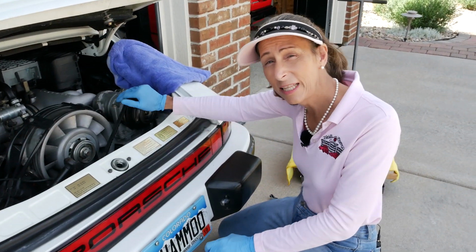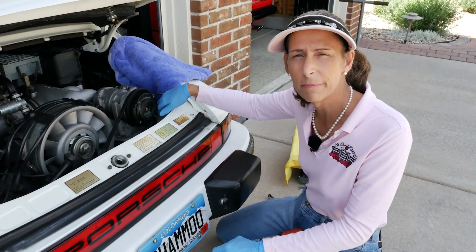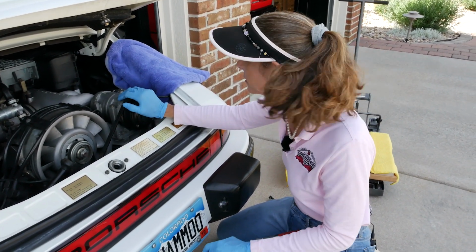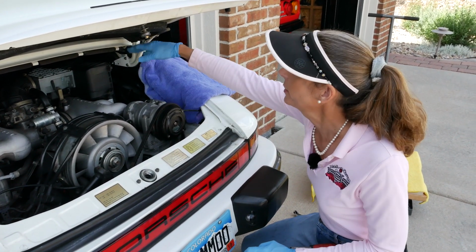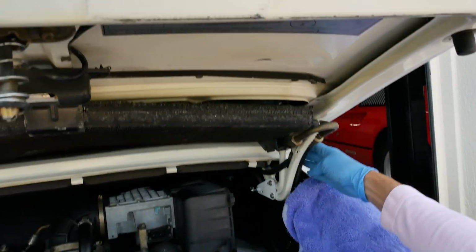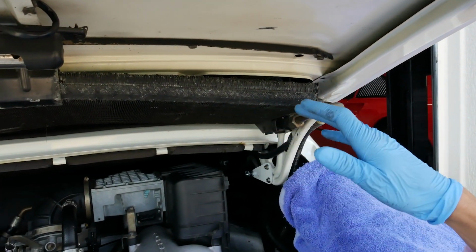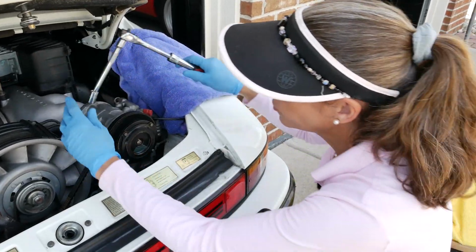We're going to start by taking the AC compressor off. It's just 4 bolts plus an adjustment on the back, but the reason we have to do this is because all the plumbing associated with it stays with the car. This, for instance, is the heat exchanger here, and all this plumbing. This is all part of the air conditioning system, so when we drop the engine, this has to stay with the car. Let me go ahead and pull this off.